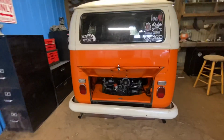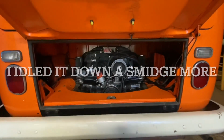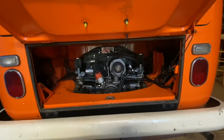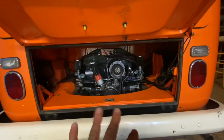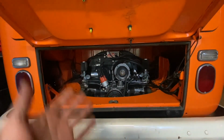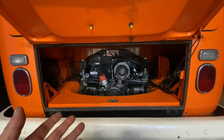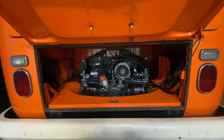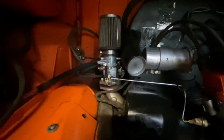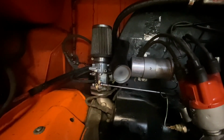Okay, it's the next day, and after tuning it, I put the bell crank linkage on there, so we'll fire it up and see how it's holding that tune. There's a lot more to it than that, and that's just a general idea of how to get things going your way. So for now, after the linkage is on, I'm going to get Kevin to put the gas pedal to the floor and guarantee that we're getting full throttle back here, because that's one of the big mistakes that I see. All right, so go ahead.